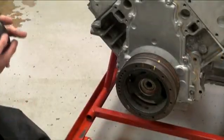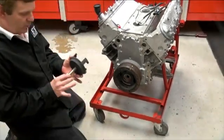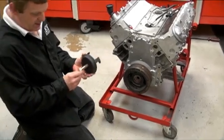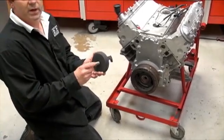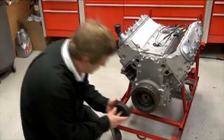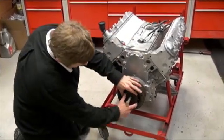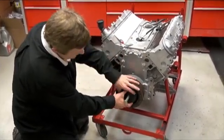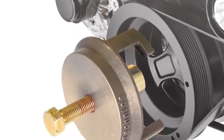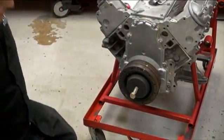We're ready to install our removal tool. One of the things G&G Technics did is make the head of the bolt the same size as the bolt that comes out, so you don't even have to change sockets — that's a cool touch. Install the tool, turn it clockwise to engage the legs, then turn it down by hand to get it in position. Make sure everything's squared up.